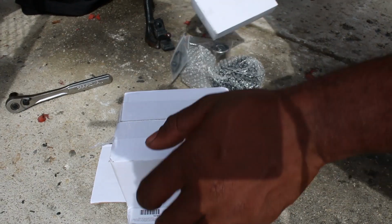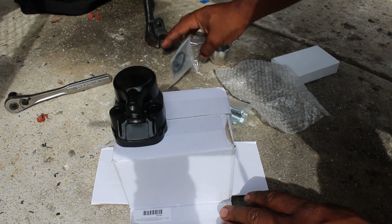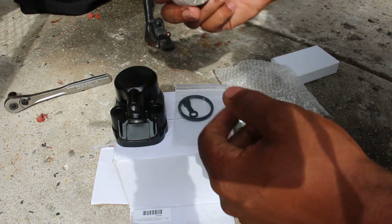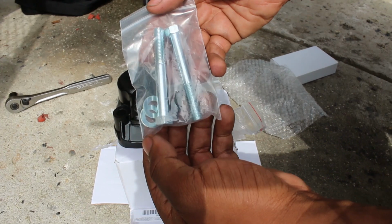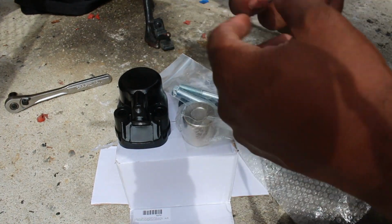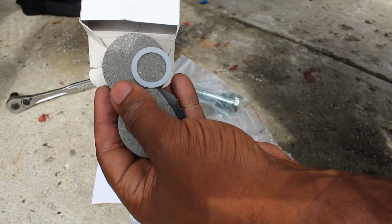Right, so the CB550 has one 2-piston caliper, or would you call it two, or is it one? I don't know. It's like this weird outdated design that only really uses brake fluid on one side of the caliper and a bracket to kind of clamp the other side of the rotor. So it's really like just a 1-piston, but it uses some type of design that pulls the other side in when it pushes the other side. It's kind of weird.